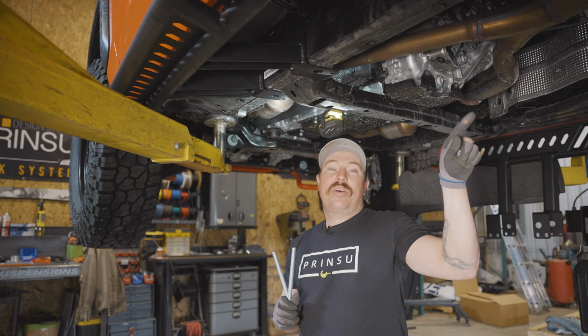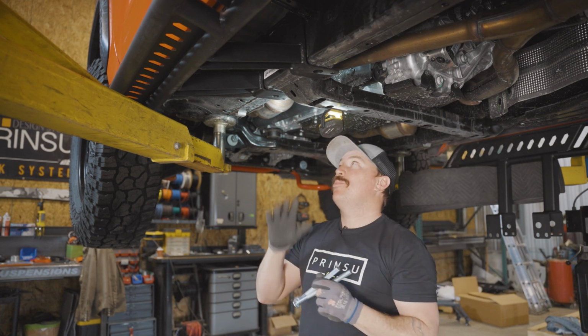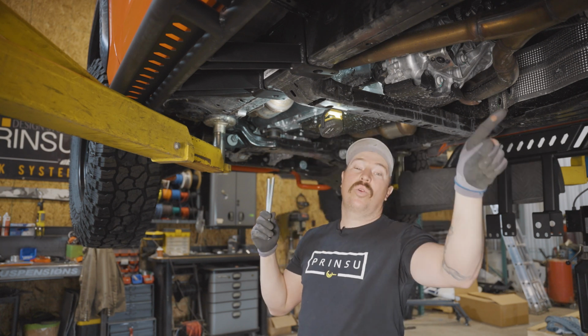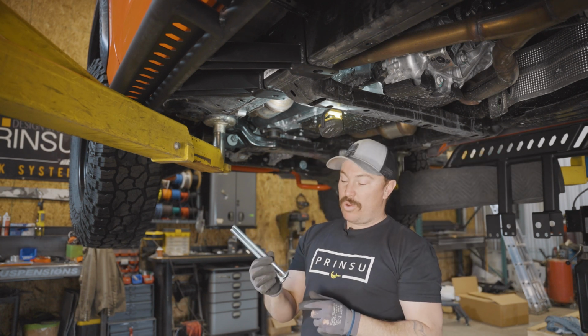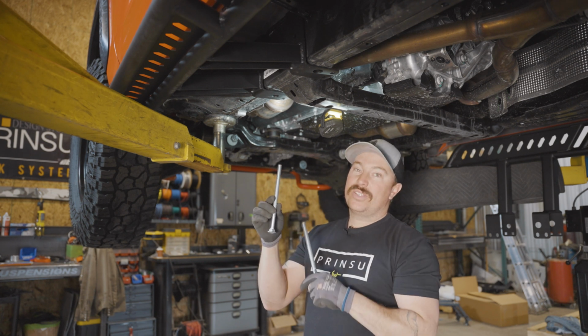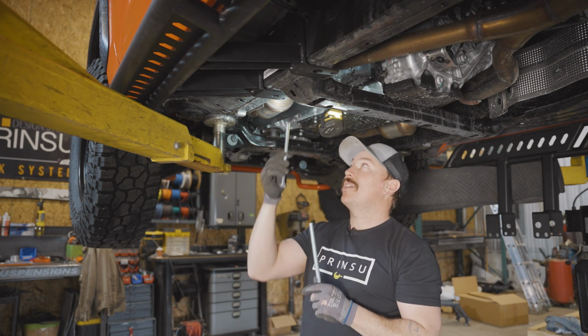All right, now that we have that bolt holding the rear of the slider, we're gonna jump up front with 2 of these carriage bolts and get these guys started. Then we'll just start working our way backwards with the carriage bolts. The orientation of these is the round head faces the ground, so they're gonna go in just like this.